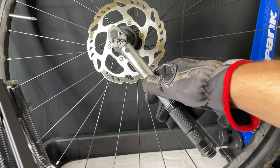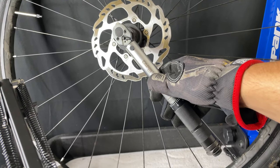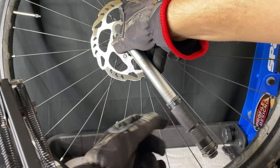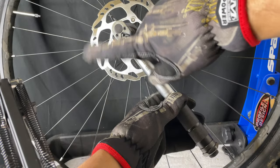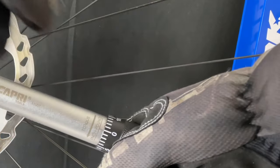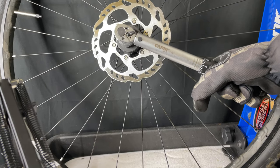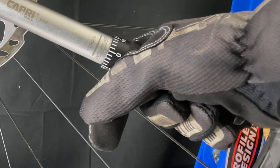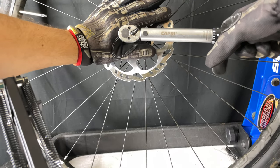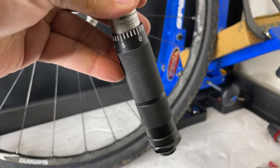To be perfectly honest, 7 to 8 Newton meters is acceptable for a stem on a carbon steerer tube. But now I'm going to show you how to use a torque wrench properly according to what my commenter said. You want to hold it down on the handle, not up there. Use your right hand on the handle, apply your pressure and torque — and there's your click.